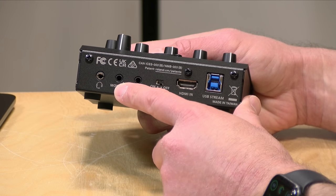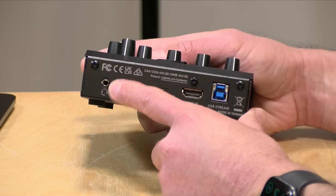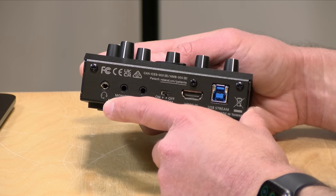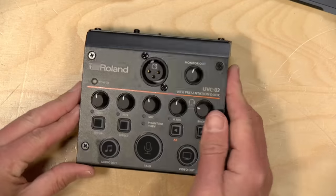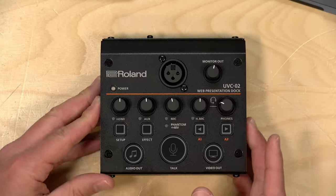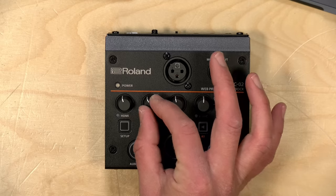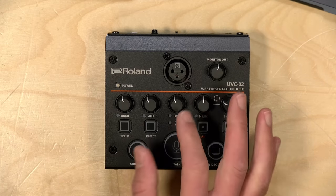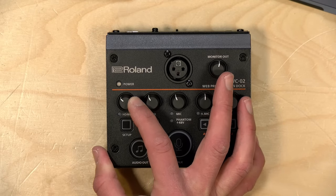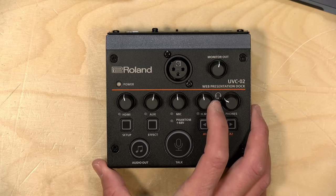You also have a monitor out here so you can plug into a speaker if you're in a production room. You also have the option to plug in headphones, and this headphone jack supports headsets with a microphone, so you can add that as a mic to the production as well and mix it all here. You don't get any level meters on the device itself, but the software does provide that for you. All of the audio coming in can be adjusted independently and then it will mix it together and fire it off to the computer. You can bring in audio over HDMI and adjust the volume, and you also have the auxiliary input and the main microphone and the headset mic dials on the front.